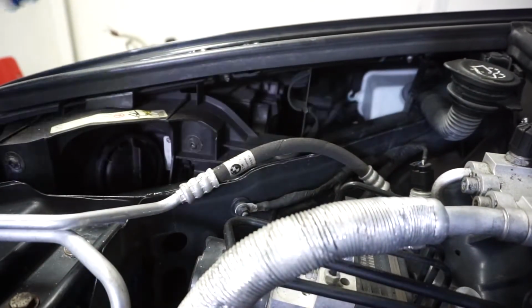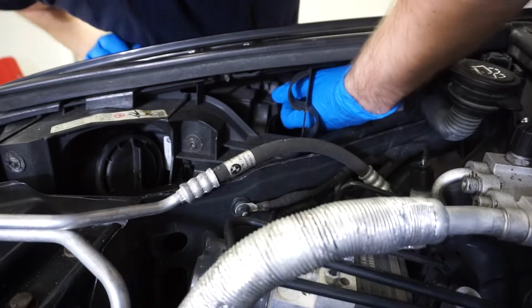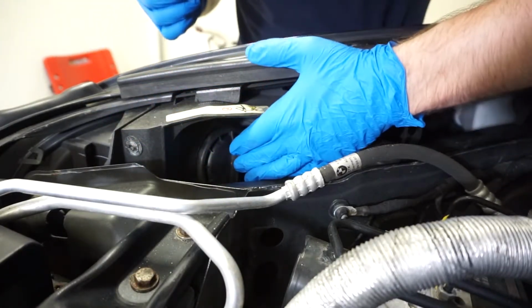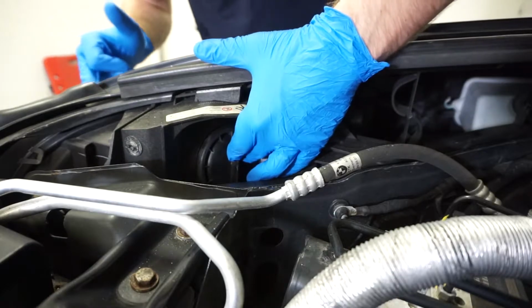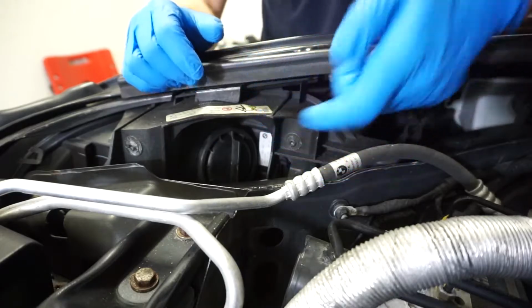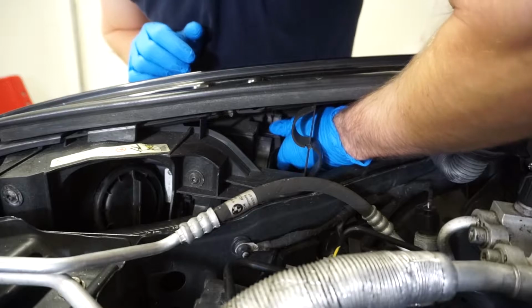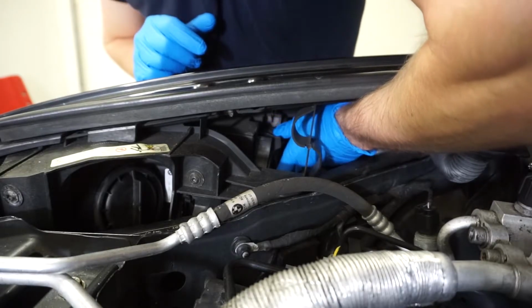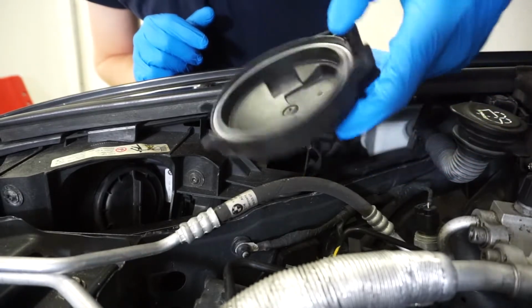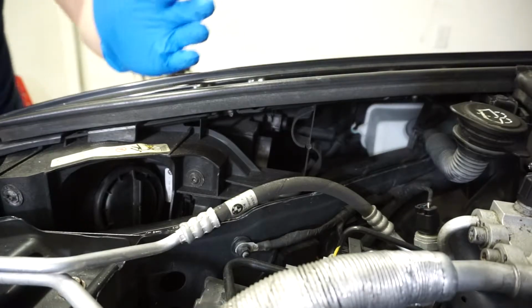Unfortunately, you're not going to be able to see a lot. I'll try to at least show you how I remove the plug here. One of the plugs is here, which is twist and turn. That one directly lights the angel eyes, which we replaced in a previous episode. The link will be in the description or right here. Basically, right under the fender, there's another plug. You simply press the button at the top and remove the plug itself. It's a pretty big one, and behind that plug we have our light bulb.